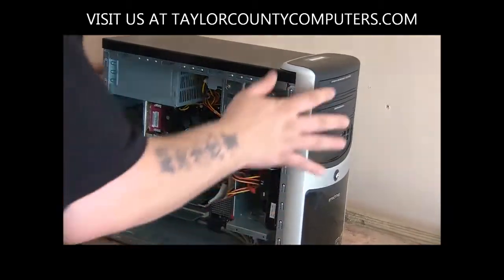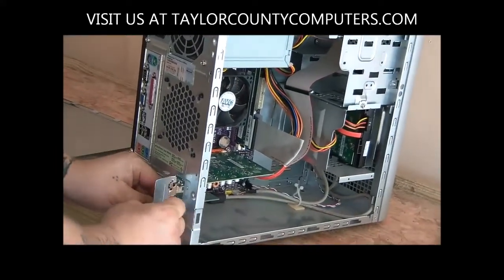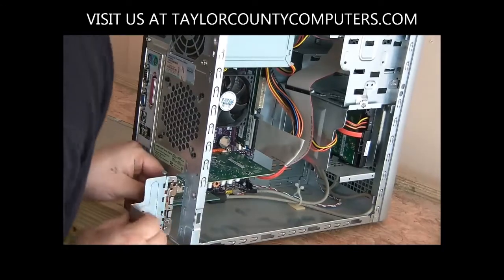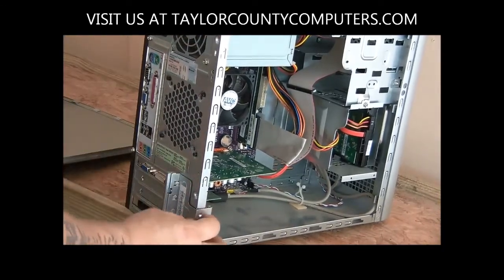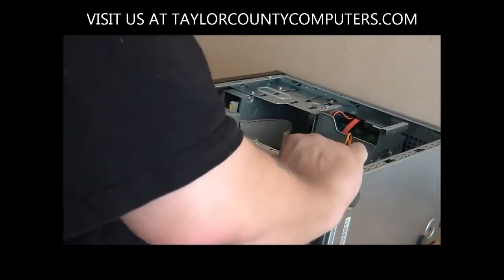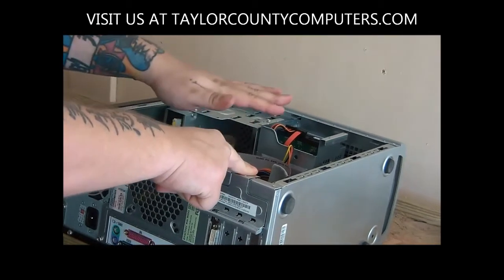Okay, put this case back together. Bring it over here. This one has that pressure clip for all the cards that are in place. But once it's lined up correctly, it should, there we go, slide right on and then lock there. And I found it's a lot easier if you can turn this on its side when you go to try to line up these grooves, because they'll all sit flat and slide right in.